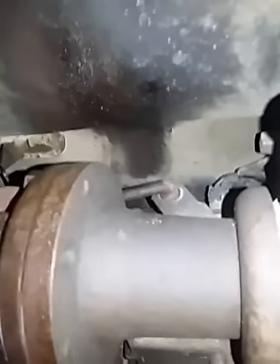You can just engage that lever and come down here — if you can't move the driveshaft, your transfer case is engaged. I believe there's a switch right up there, and once you engage the transfer case it sends a signal up to the actuator — it's called a thermo actuator on the differential. That plunger then goes in and locks your front end.